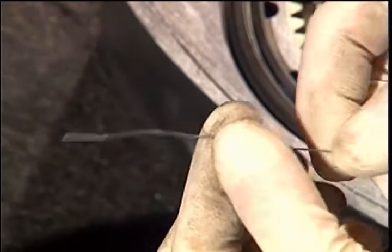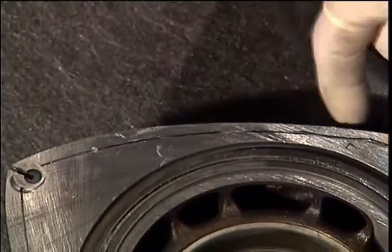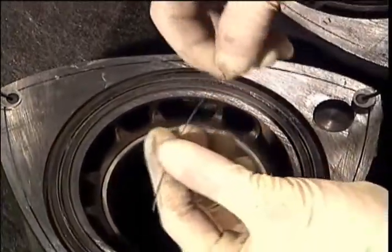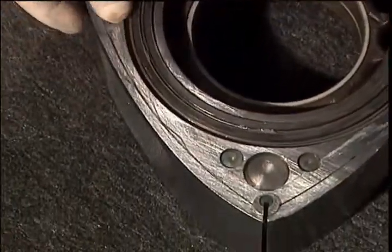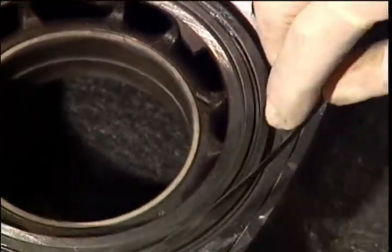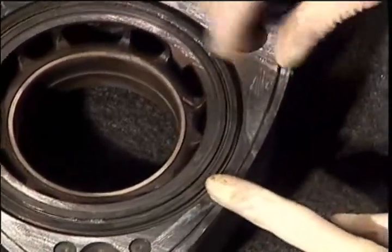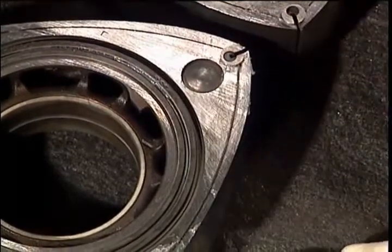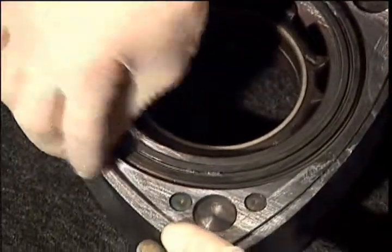Make sure you install side seal springs with both ends facing up toward the seal. If you decide to reuse side seals, make sure the shiny side faces up away from the rotor, because the spring side will have small grooves on it that may never seat properly. New side seals need to be trimmed to fit. Be sure to polish the end at an angle to match your corner seal.